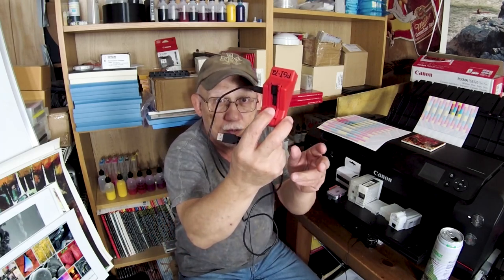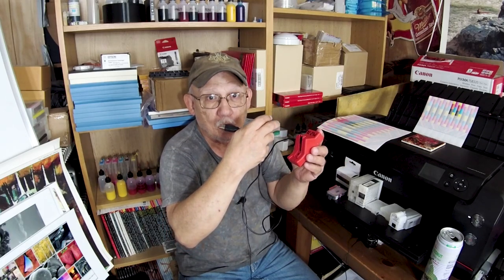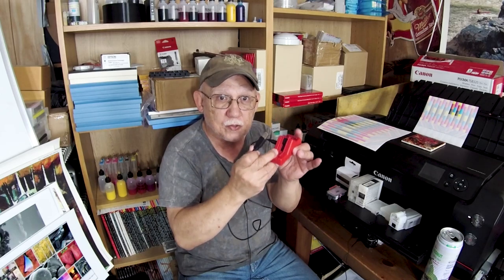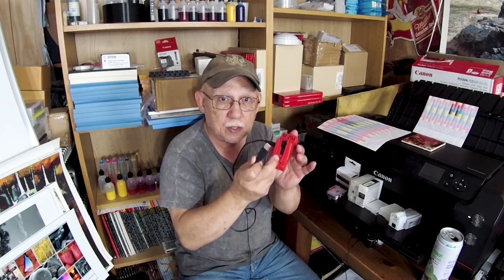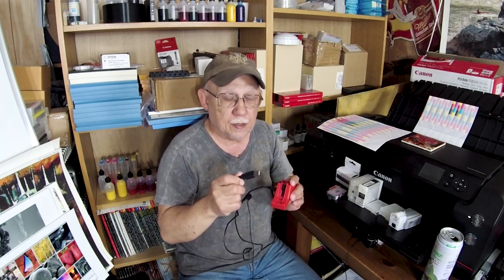So from the get-go, take them apart and install a brand new battery that you buy either from Amazon or down the street at the local store, to make sure that you are able to deliver the proper voltage to the chip. There are little contact pins here — you slip the cartridge in place, a light will flash and then it will just go full, and the light will then go out. You plug this into your USB power source so you have a constant supply of power. These are the best and most reliable resetters, and they only come for Canon printers — some of the early models including the Pro 100 and the Pro 10.